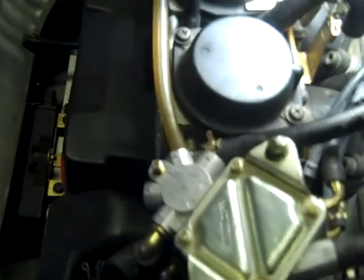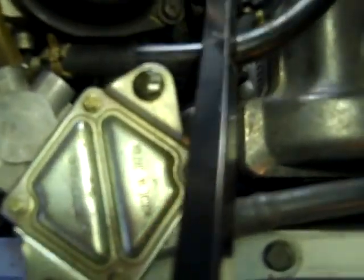There's a vacuum hose right there - be careful not to get into that. Be careful not to remove it - it's trying to fall down on me. There we go, got that side pried loose. The carburetors are loose from the manifold, from the intake insulators. Be careful not to remove the carburetors completely yet.